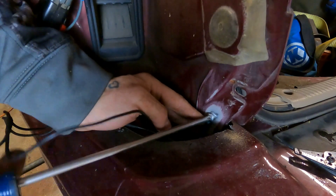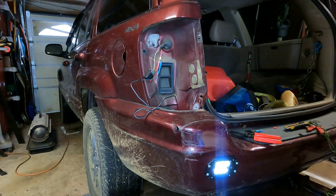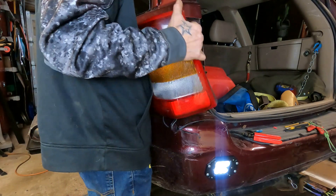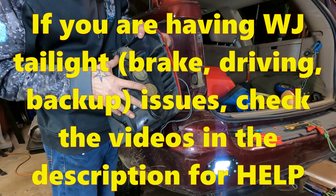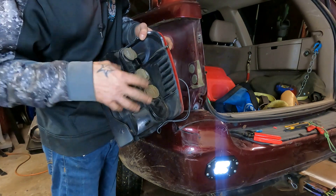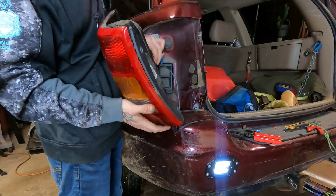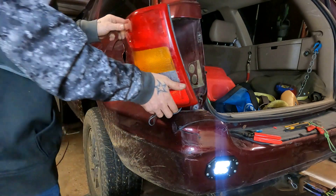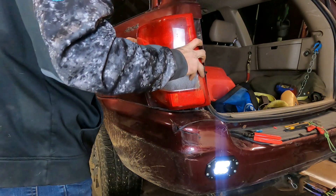You can absolutely put dielectric grease over this, paint it, whatever you want — I think that looks 10 out of 10. Now another reason I'm doing this is my taillight backup light does not work. I have a video up on how you can replace the entire circuit board on these WJs because it goes bad — I tried replacing the bulb and a few other things but it's going to need a new circuit board. If you're having that problem I'll leave you a link. But I've got a backup light on my bumper now so it's okay. Plug this bad boy back in, lock your red tab, make sure everything still fits. There's enough room behind these taillights to accommodate that wiring and those terminals.